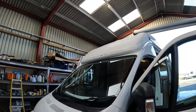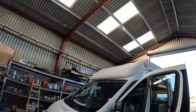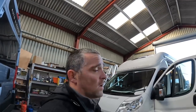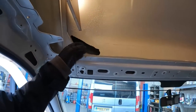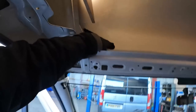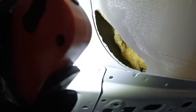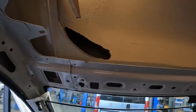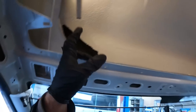This little Auto Trail is proving to be extremely difficult. I've now resealed all of the roof seams and the skylight has been done, so everything as far as we can tell is no longer leaking. However, because of the construction, there is no way I can get in there to dry out this section. There is actually insulation behind here — you can see it — and that is sopping wet. Every time I try drying it out, there's a little puddle at the bottom, and I don't know whether it's the insulation or water draining off it.